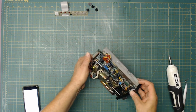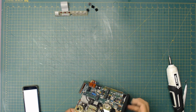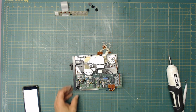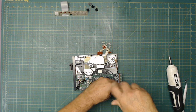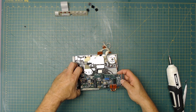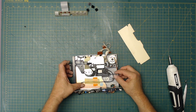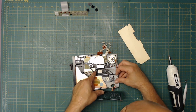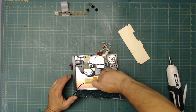And now we have the disk drive itself. Let's see. I was trying to see if that part was in here flopping around. Got one screw here that holds this down. I'm taking this off because the read-write head isn't moving. So I want to gently get that thing loose. Let's see, it's stuck here. Oh, the stepper motor was stuck. There it goes. Now it's moving.